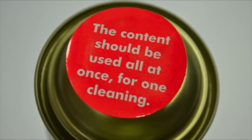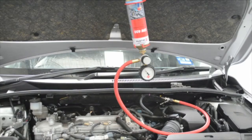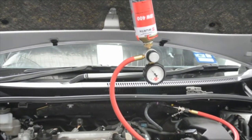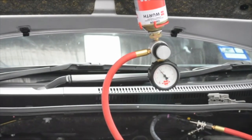The can is suitable for a single vehicle application. The LBW400 aerosol will now remove all traces of oil, grease, and carbon residue from the fuel intake system. As the cleaning fluid is delivered by the vehicle's own injection system, the cleaning process is targeted toward the components of the engine that will directly benefit.